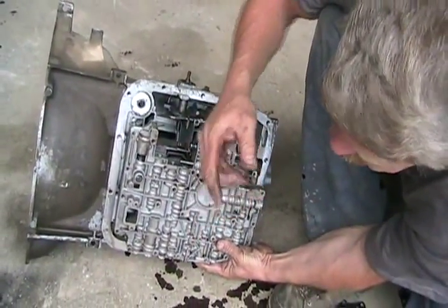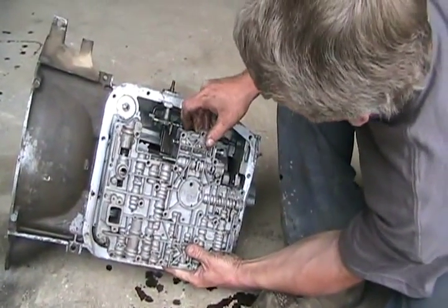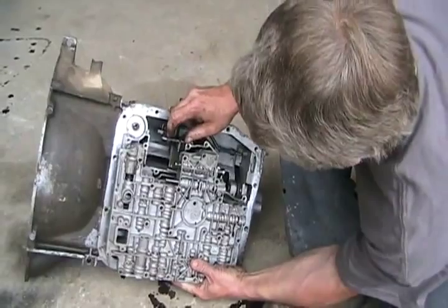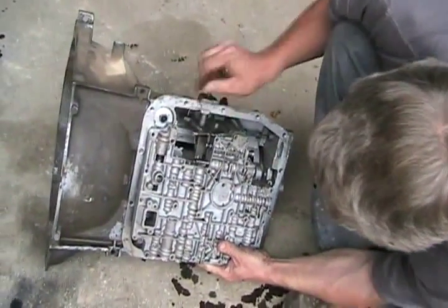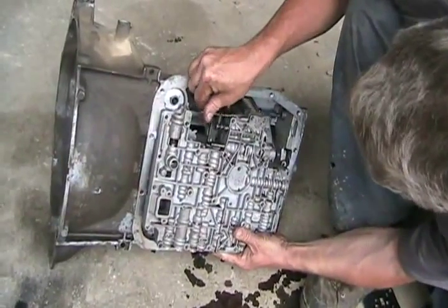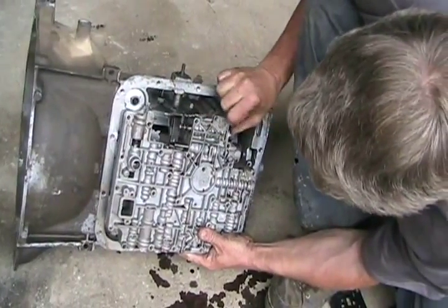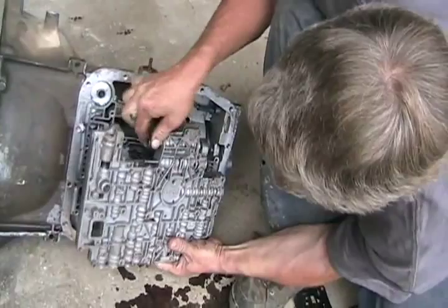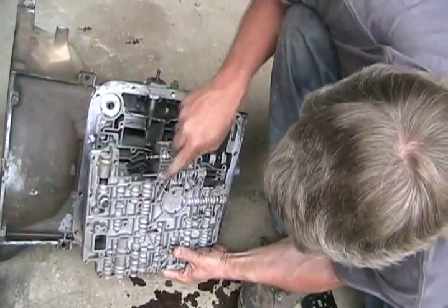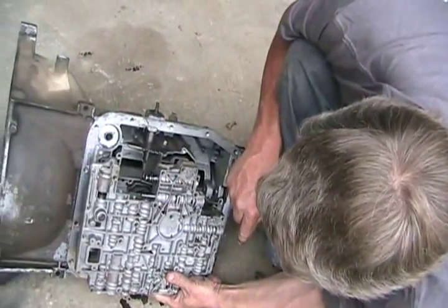It changes the range when your gears shift in your transmission. But gears don't actually shift — it's those bands and clutches. When you want to select your different gears in your transmission, like forward, reverse, drive, neutral, all that stuff, this is the lever that does it. That's hooked directly to your shifter arm, and it just moves out this little piston, sending oil to different places to put your transmission in the appropriate gear that you've selected.